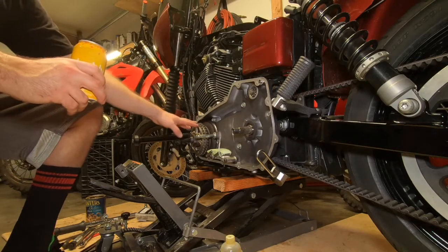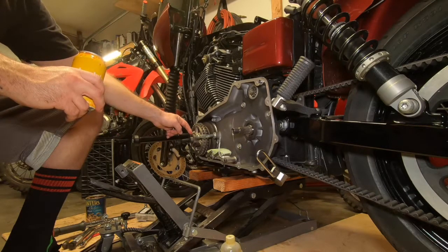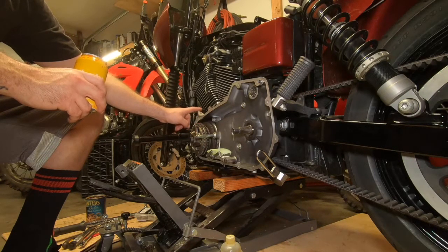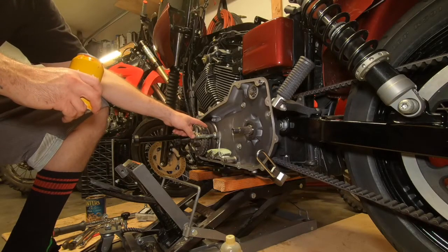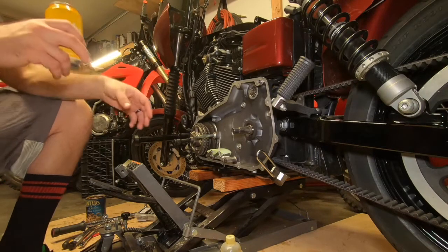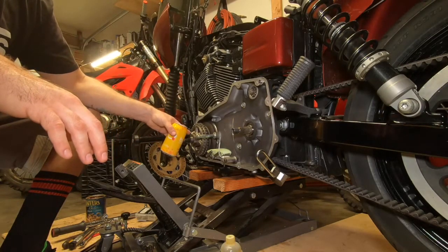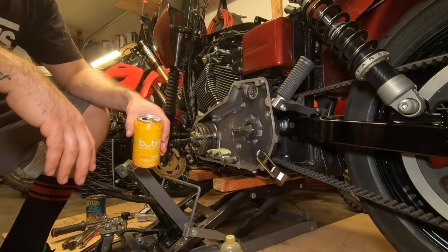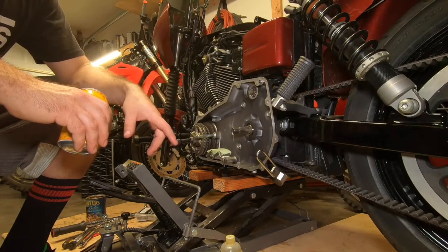When you do take this apart, try to mark your stuff, this being one, the sprocket, or one, two, and then your washer, bearing, washer, sprocket, crown, and then all your stuff. Try to mark it all down and remember, and it's gonna be a while, put a little letter to yourself, put it in a Ziploc bag, and put it in there with the nut and the washer and the bearing so that everything stays locked tight, air free or whatever. Don't get dust on it, and you'll have a little note there telling you next time you're working with it.